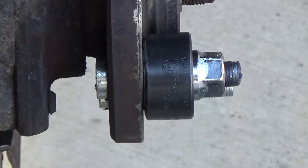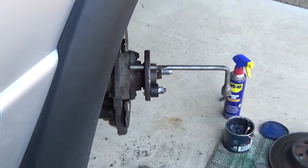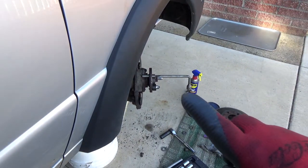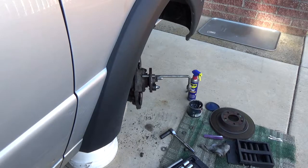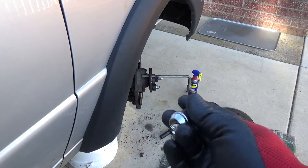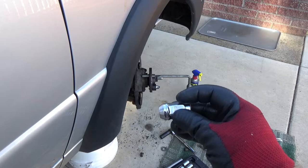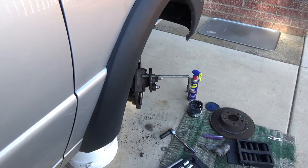That one actually went in really good. So, got a little workout there. I think putting the grease on the threads and using that open end nut helped. I was trying these closed end ones. Sorry, I'm out of breath. They do trap air in there, so maybe, I don't know. Although I'm surprised at how well that went in. So I think greasing things up really helped out. That first one I tried was rock solid, but of course, I didn't put any oil on there. I just went at it.